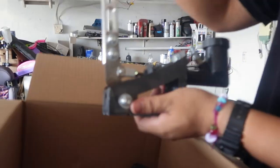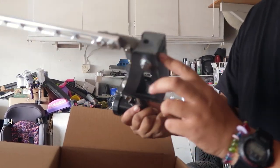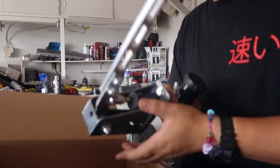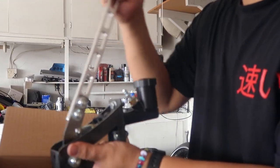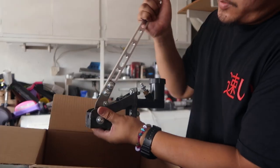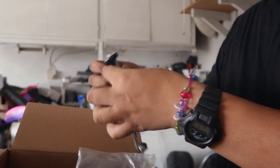So this is gonna be the handbrake right here. The build quality is solid, I like how everything is already put together. I might probably weld this into the car, and I see there's already holes drilled, so that's awesome. I'm gonna make a custom bracket — we have to figure out where it's gonna be mounted, because I sit all the way back and Christine sits all the way forward. Where I originally wanted to mount it wasn't gonna work because the seat has to move all the way forward and all the way back, so I might have to mount it a little higher.